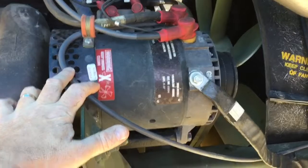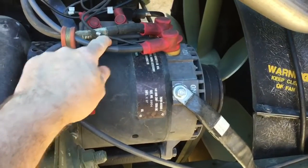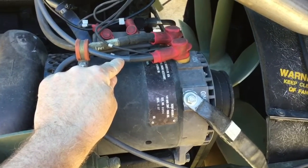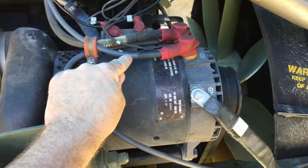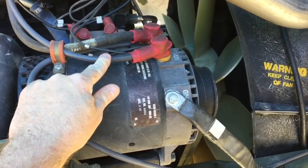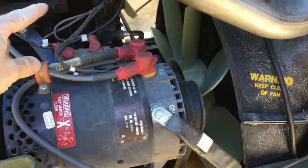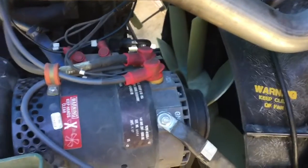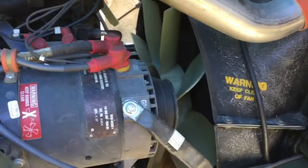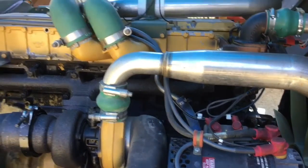The line coming off the alternator is now the 24 volt line feeding the cab. The other large 24 volt line goes back to the positive terminal on the starter solenoid, and from the solenoid a battery lead runs back to the 24 volt battery output of the battery box. This is still the dual volt alternator, so to operate properly and give full output it needs to see the 12 volts out of the middle of that 24 volt battery. That former 12 volt cab line was long enough to reach all the way back to the battery box. Two old STE lines wired to 12 and 24 volts feed my dual voltage voltmeter up in the dash panel, giving direct alternator output and battery voltage.